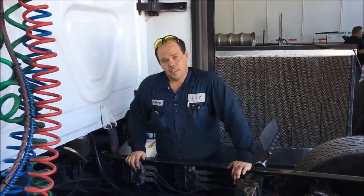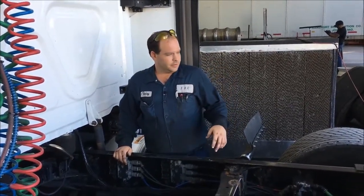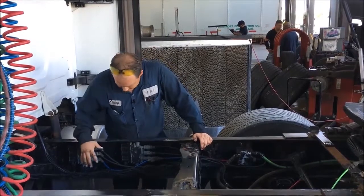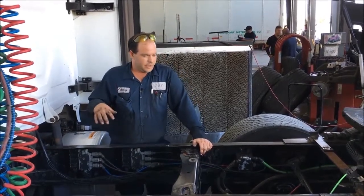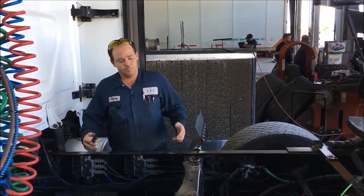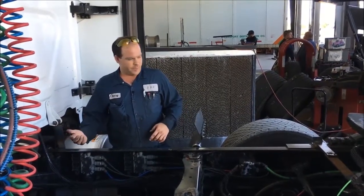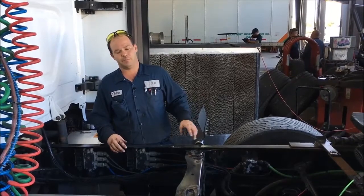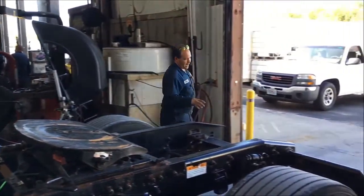It's Henry from TDC. Today we're going to talk about the ECAS, electronically controlled suspension system, on our tractors. It's equipped on our tag axle tractors, which is basically a single drive axle with a free rolling back axle. These two valves right here are the ECAS valves — you got your front valve and your rear valve. The ECAS system is completely electronically controlled. It's hooked into the electronic traction control so it will take pressure off of the back bags and apply them to the front bags, giving you more traction. The height sensor is no longer a leveling valve — it is electrical.